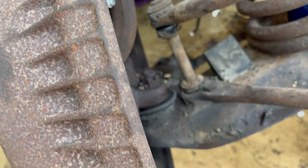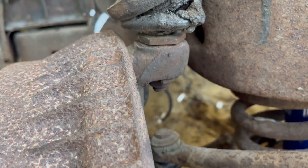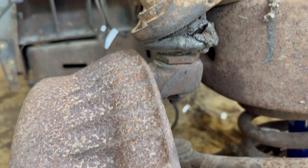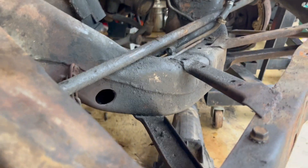You can see the worn out upper control arm. I don't know if a lot of people know about this if you haven't rebuilt one yet, but this is where you adjust your camber — you see that nut there on the bottom of the upper control arm. That's something that's kind of different on the Cadillac that I haven't seen elsewhere.